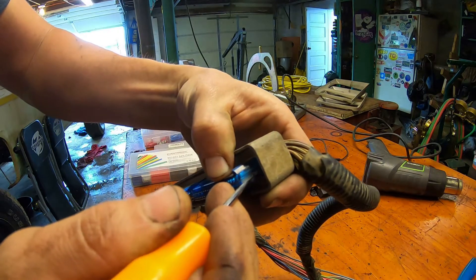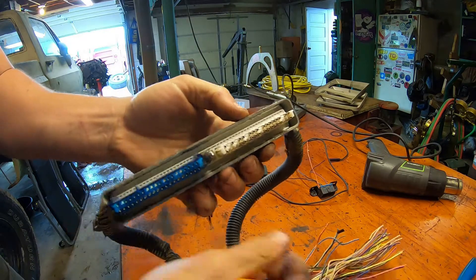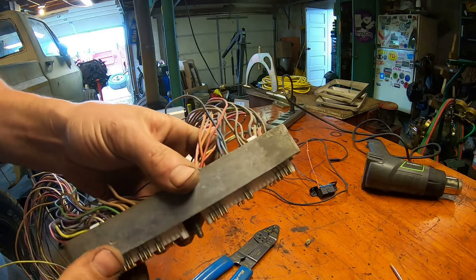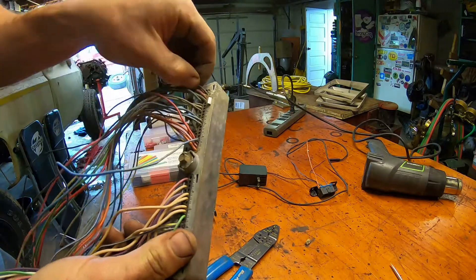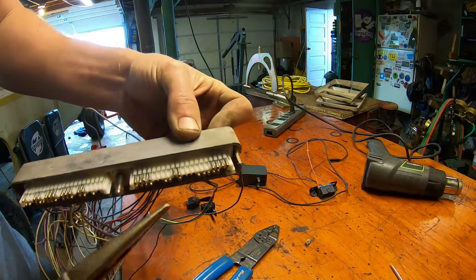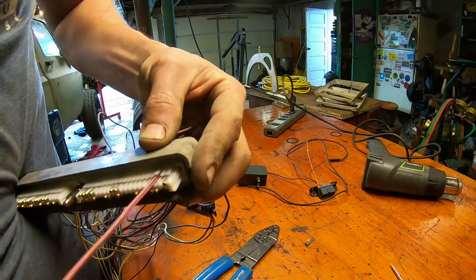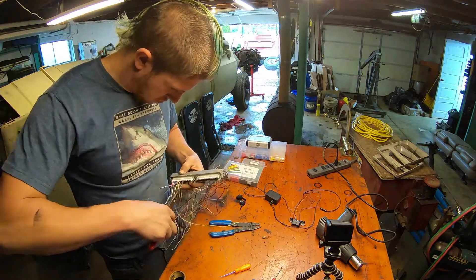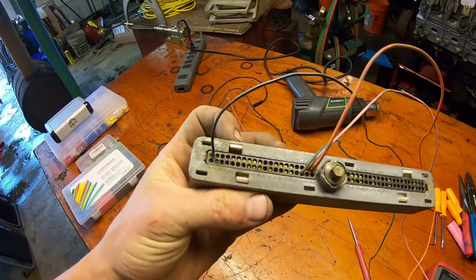There's just a little clip down here on the side. You press that in and your blue cover slides out. You've got your little pin right in here — just press it in. That side's loose. Same on the other end, just press it in. That cover comes off. Do the same thing on the other side. I'm going to depin this connector and get out all the wires that I don't need. All of the connections are labeled by number right here at the top. I've got my connector depinned.